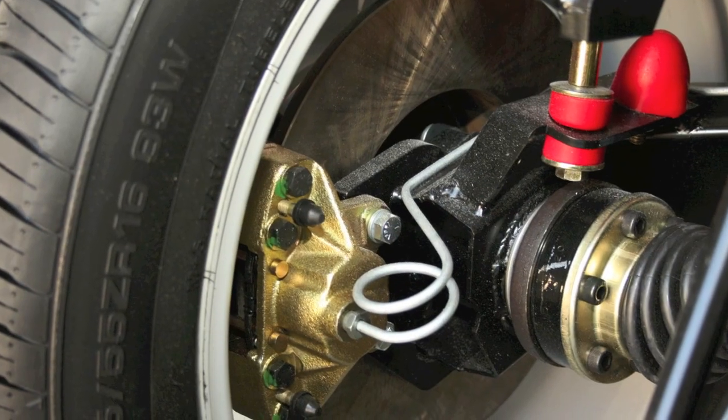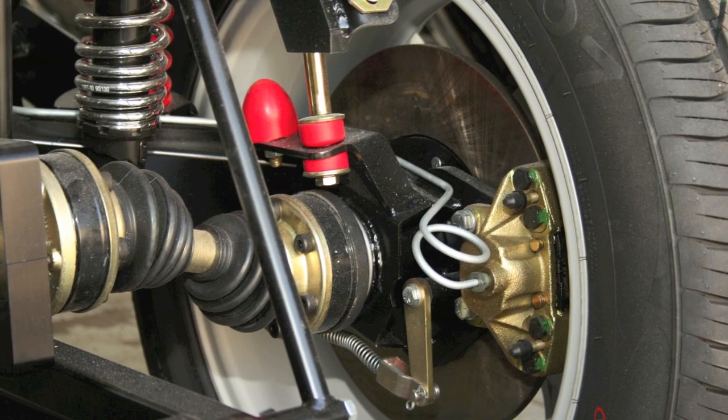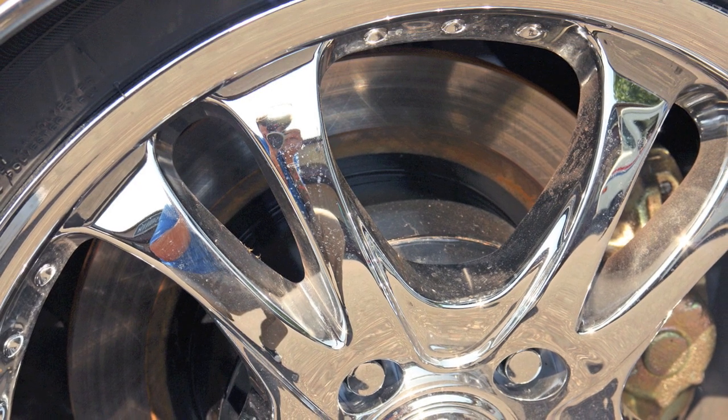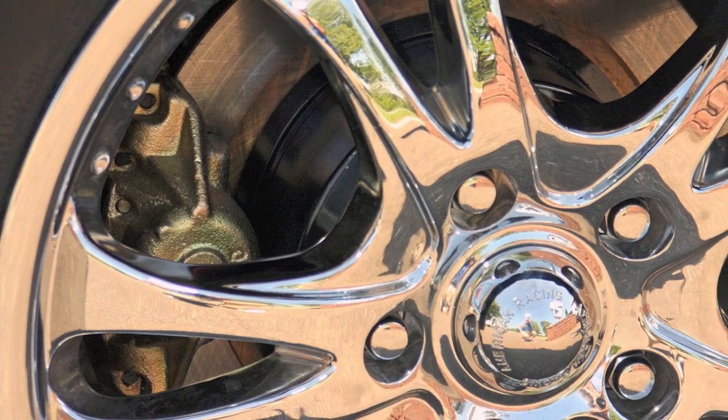As with the previous chassis, the brake system utilizes an automotive 11-inch rotor and caliper that are available at most auto parts stores. Here again, we do this to provide a heavy-duty solution to a light-duty application while assuring that wearable parts for the trike kit are always available. There is no maintenance required of any kind.